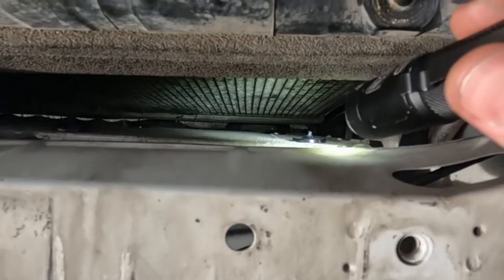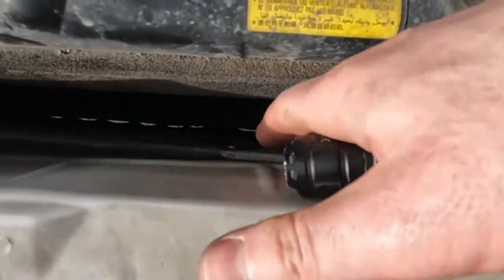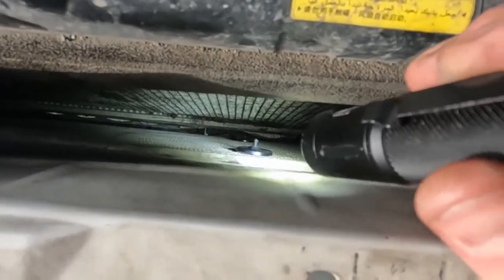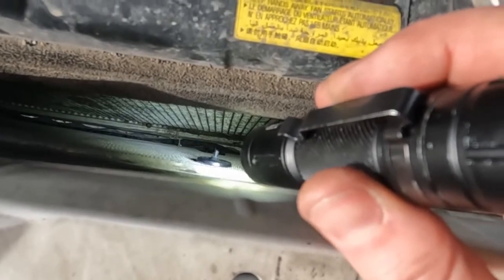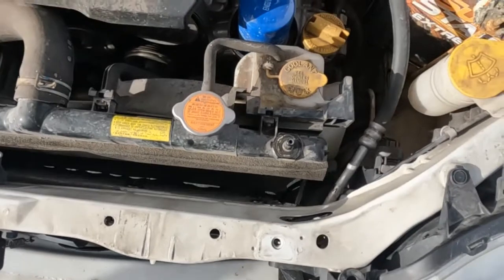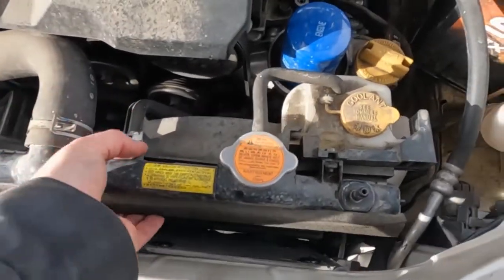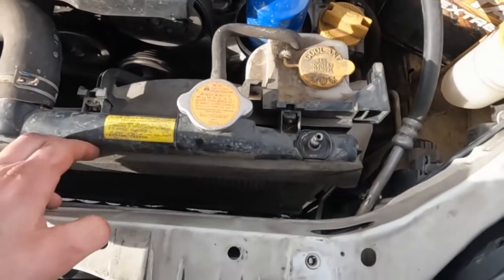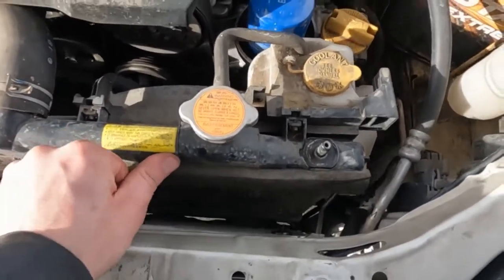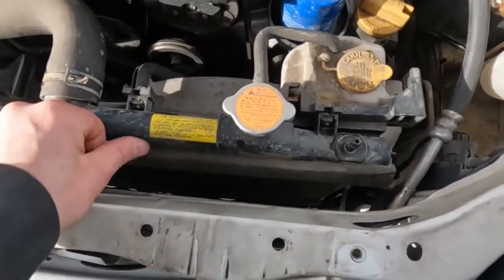You have it cut back enough for clearance, but you also have it sticking out enough, because how it works is it has little notches in it, so you don't want to cut it so short, because then it might not be as secure. I was also able to pull the radiator up. So I pushed it forward and pulled it up out of its bottom piece just a little, and that helped push it forward even more, just to get my chubby hands down there. But I think that's it.